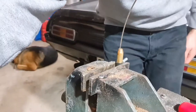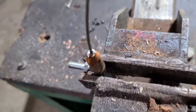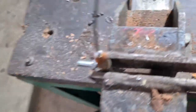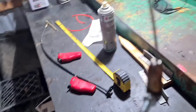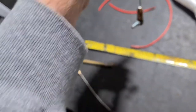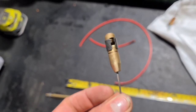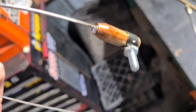Then what you can do — it sort of tries to untwist — so just grab the wires and twist it back around how they go. That tidies it up a bit more. Any bits that are going to be a little bit longer, just do a trim. And to make it look a little bit nicer, just heat it up a little bit more again and put some more solder into it to finish that end off a bit nicer. So there it is. You can buff this up if you want because you get a bit of stain on it — I used just a gasket buff and cleaned it up. That's your finished product. Give it a test, give it a big pull, and if done well enough, shouldn't really have an issue.